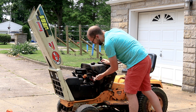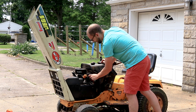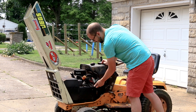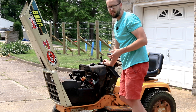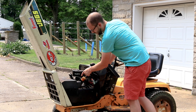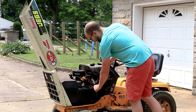This fuel pump's about $20 — I'll put a link in the description. It's a low-pressure fuel pump, and I put a fuel filter on the downstream side of the pump. The reason I put it downstream versus upstream is that if this diaphragm were to disintegrate five or ten years down the road, I don't want to send all those little rubber particles into my carburetor. So I prefer to have the fuel filter on the downstream side.